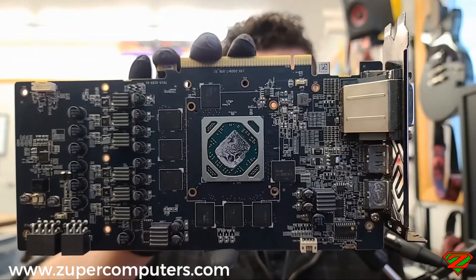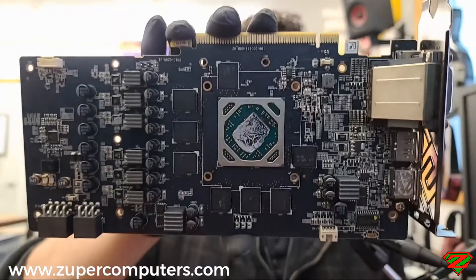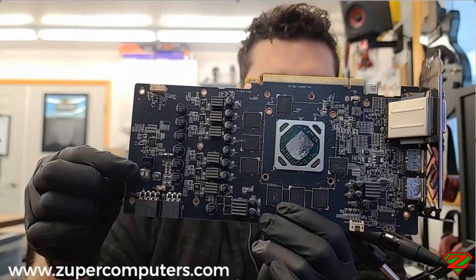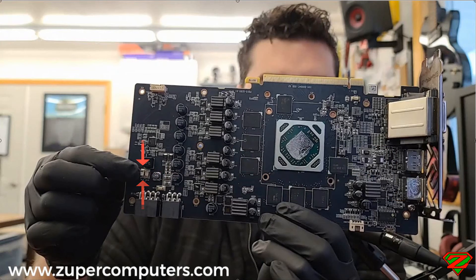Here's what we're working with — the card completely disassembled, heat sinks off. Everything visually looks fine. I'm going to freeze frame right here: where my finger is pointing on the left, there are two surface mount fuses. A fuse, when you put a multimeter across it to read resistance, should be a short from one end to the other. If a fuse is blown, there's no contact between both sides, so it reads as an open lead. Those two fuses on the far end both had open leads — meaning they're blown. Other fuses on the card checked out fine.